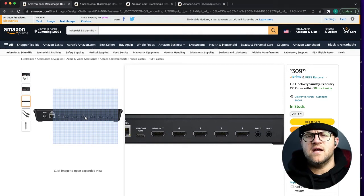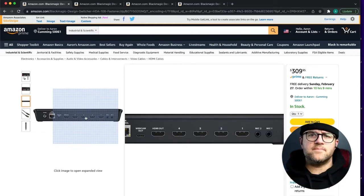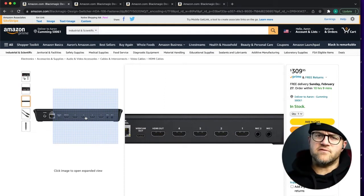So if you run audio into your camera, say you have your front of house console and you run your audio into the camera from there and then send the camera feed up to a switcher, that will work just fine, guys. But if you want to integrate external audio, if you have a mixer in your video production booth, I highly recommend skipping this version and moving up to the next three that I'm going to talk about specifically,